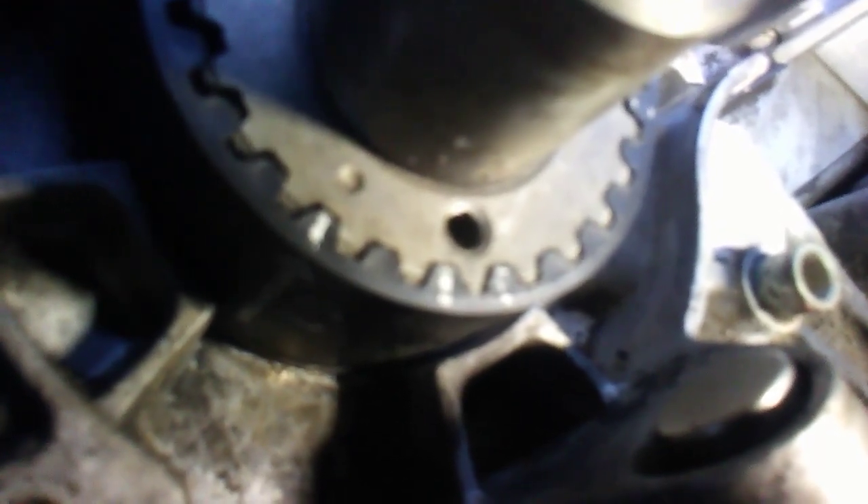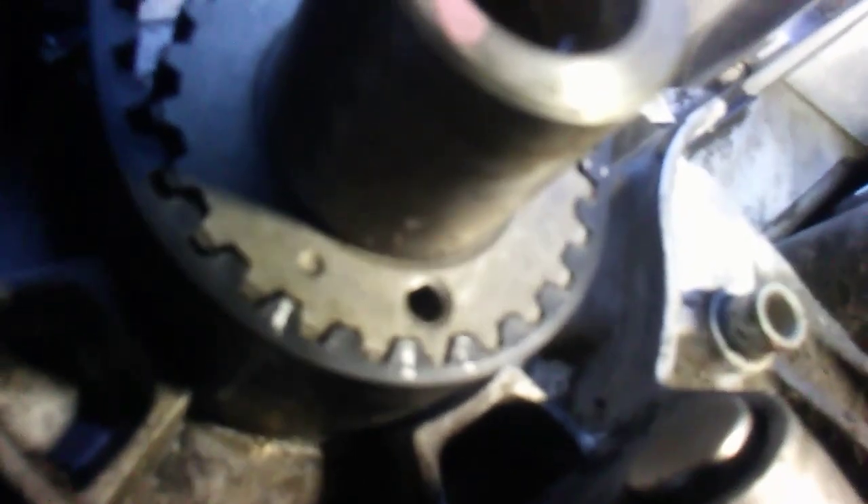Feed it around, and you can see on the bottom. Let me go onto the car and show you how my timing marks all lined up perfectly. See that dot? The dot lines up with that point mark, and the two dots line up with the hole. That's how you know you're perfectly in time. If it doesn't look like that, you messed up, and you might have to turn your crank slightly to get it in line.